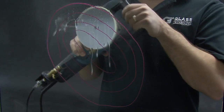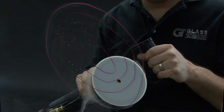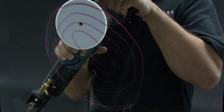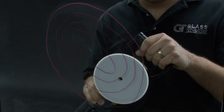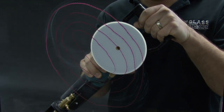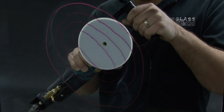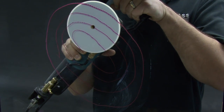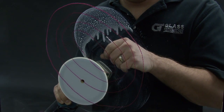Wet the glass and run the polisher over the area a couple of times before adding any more water. This lack of water will increase the friction and break in the new surface of the white polishing disc. When small amounts of water are added later, the polishing compound on the surface of the disc will begin to loosen, evident by a milky coloration of the water mixture. This technique will accelerate the material's effectiveness. After achieving this effect, continue operating the machine for several more passes.